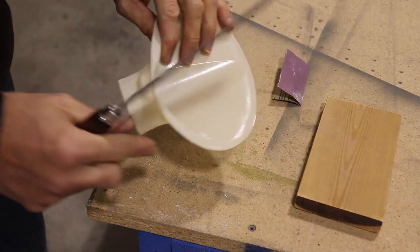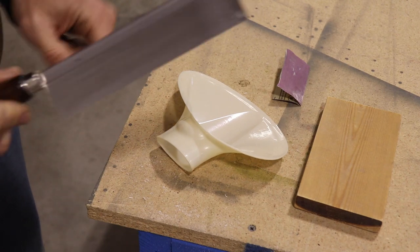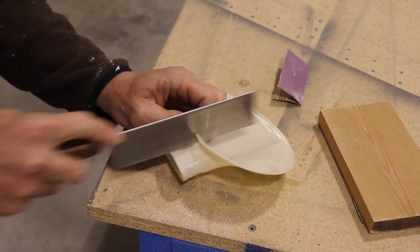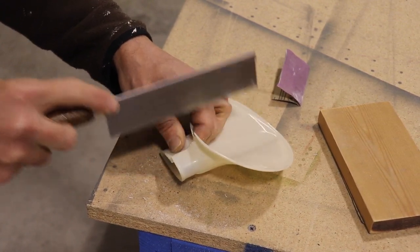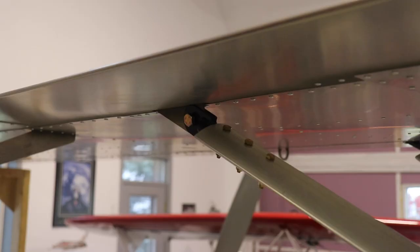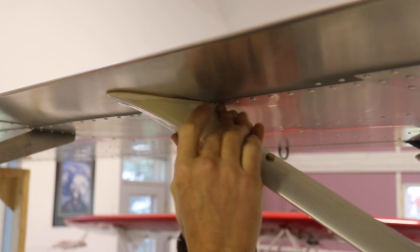The next step is to split this so that it can be spread apart and put on the strut. I'm going to do that right about here, and that's where this particular saw comes in really nice because it's super thin - it makes a super thin cut. Now we have it split. Once it's on the strut you can put it back together and you'll barely even notice that it's cut. You want to carefully spread it apart and put it around the strut - just like that.